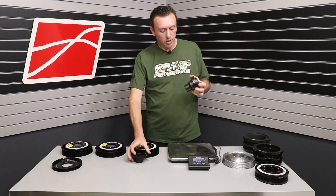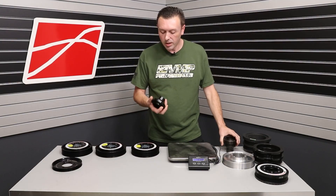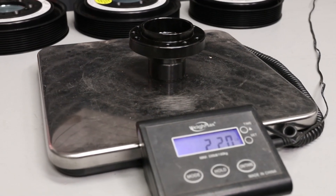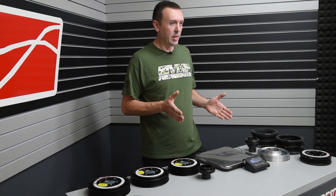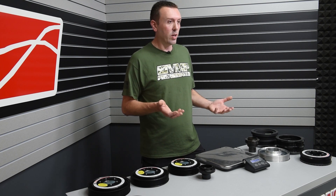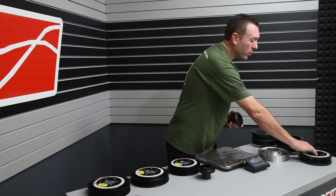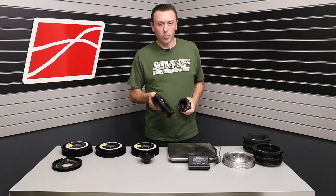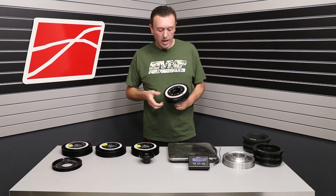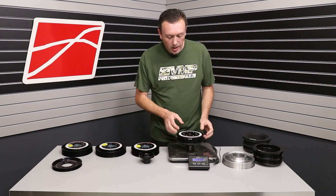This is the original design — you can see it weighs 2.7 pounds. This is the new design — it weighs 2.2 pounds. The reason ATI did this originally is because the AC compressor just didn't need to be driven in a race application. So you would install the front pulley that drove the alternator and water pump as critical items, install this, and you'd have a pretty lightweight combo. It comes in at 8.3 pounds.